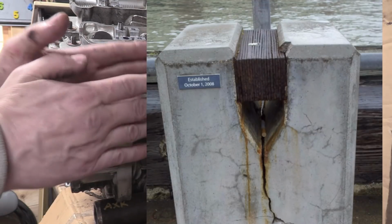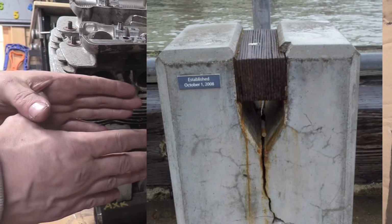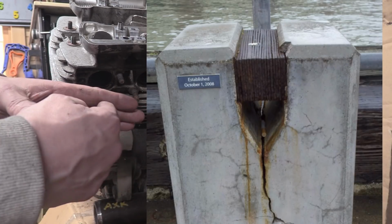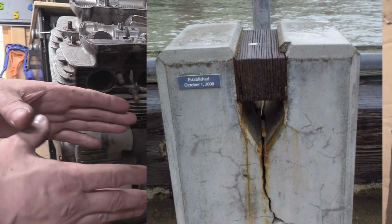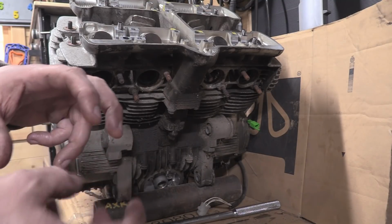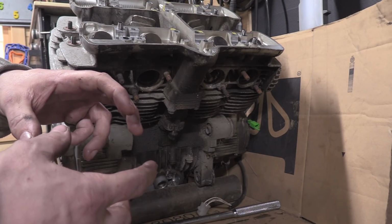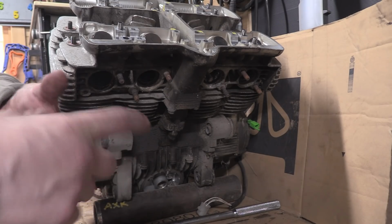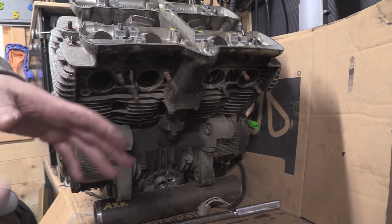This is basically a bit of cement that has got a gap in it, a bridge. And they put steel in there and let the steel rust, and it's enough force to crack. When all the molecules start realigning because of the oxidization reaction of the rust, it's like ice, right? They reform into a different lattice, and it can push outwards.